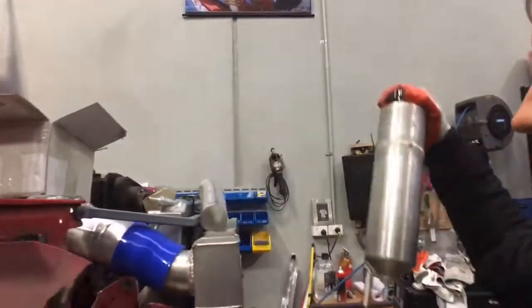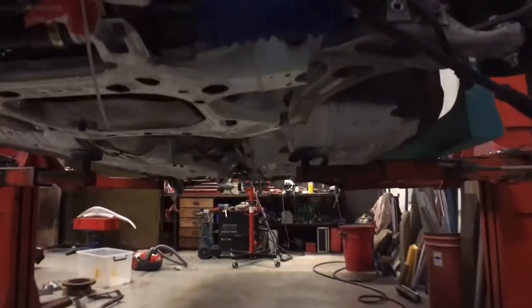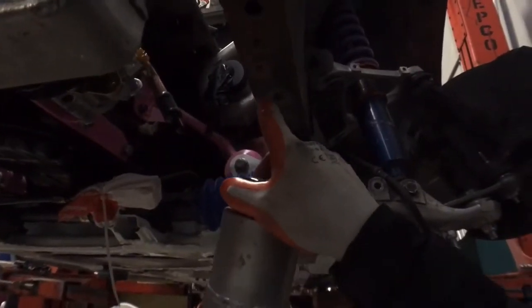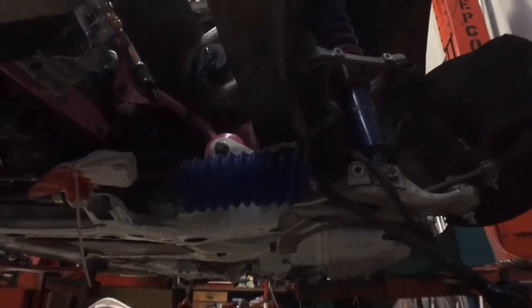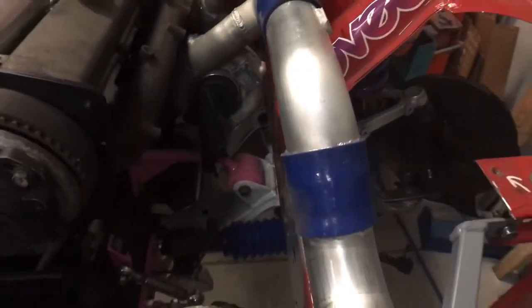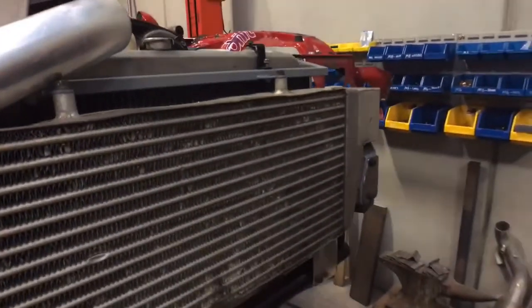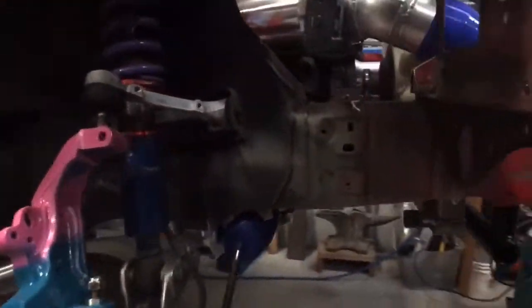So it's a bit of puzzling today. And also the power steering pump, I need the reservoir, which I'm going to put here. So I think I'm going to get a 2-inch alloy pipe and cut it in half and then make a long tank, a funny shape down low on the chassis rail there, because I also need to get the turbo intake down through there somewhere. The other corner up near the wastegate is all free, but I'll probably just put the oil catch can up there. But to start off with, I need to get the knuckles on.